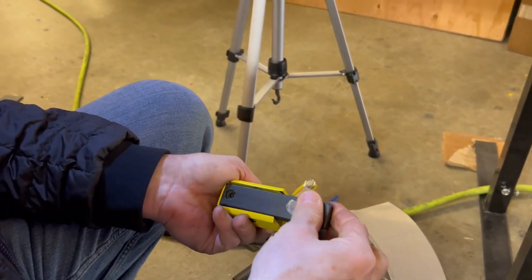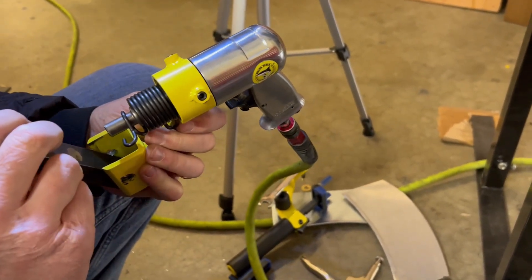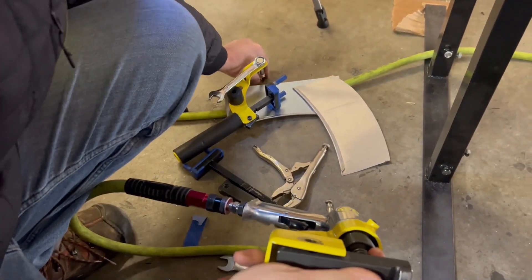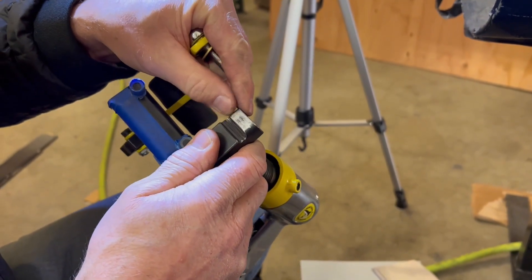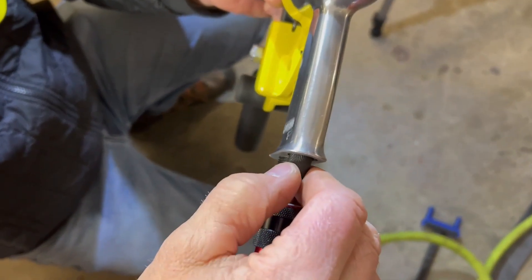Let's begin with how to operate the tool for best results. Firstly, you'll have to choose which hammer you'll be using. The steel panel's hammer is plain, while the aluminum panel's hammer is marked A. Secondly, you'll pick the working side — flat or beaded. Thirdly, you'll adjust the regulator on the air hammer to one quarter open.